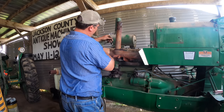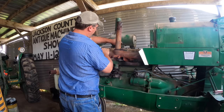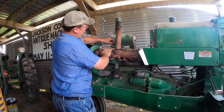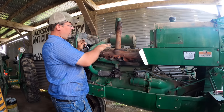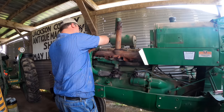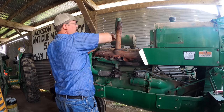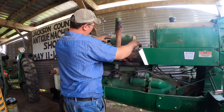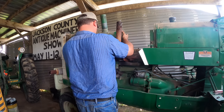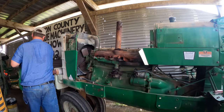so if you ever do a head job, and then you come back and work on your tractor, what I'm saying is if you take these studs out, the long two, you can see where they go, because they got to hold the air cleaner. And it's different on every one, because the air cleaner goes in different spots on different models. The 1855 being turbo, it's mounted crossways back here, so the long studs are in the back. You know. So that's what we're going to do. Air cleaner delete.